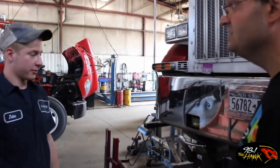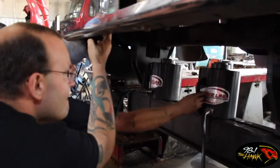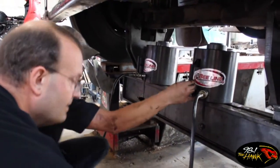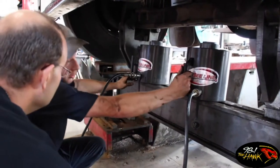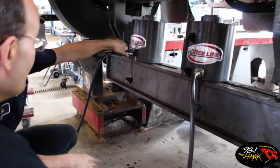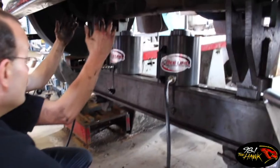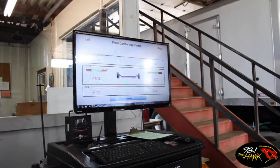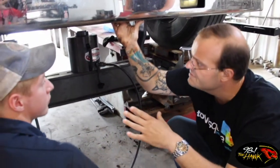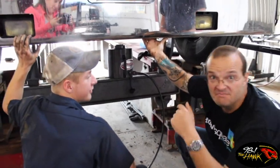We're going to bend an axle. We're going to bend an axle? Yes. Hopefully you have some tools — yeah, that's how we have to have it set up. These are air jacks, right? Yeah, these are — I think they're a hundred and twenty tons a piece. So that'll lift a little bit. We've got them all set up, got our collar closes, everything's good. You're going to hit the go button and this truck's going to go up in the air. We're going to bend it because it's negative right now. On a car they just move some bolts and stuff and then everything's in place, but on a truck you actually have to bend the axle to get it to work. Awesome — let's bend an axle.